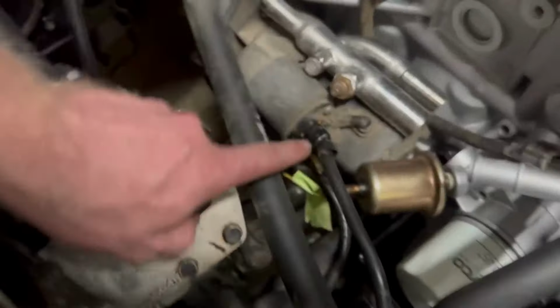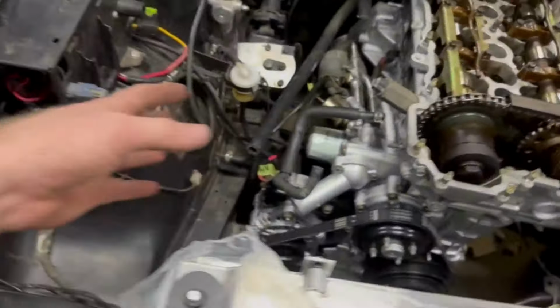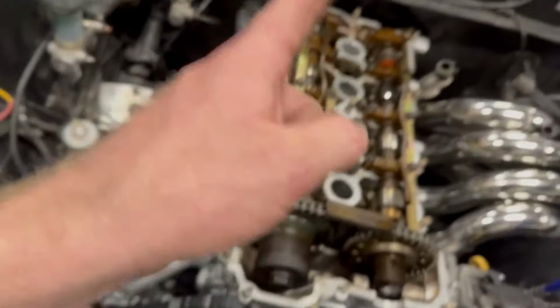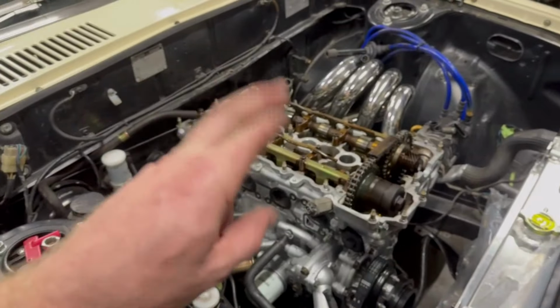You can see here, starter hooked up, alternator hooked up, alternator plug in. So battery wiring sorted out. It's literally just bolted up. All the L20 wiring has bolted up for the battery and alternator and starter and everything. So you know what that means? There is oil in that engine. That means we're about to put some power to it and kick it in the guts. Not quite. I'm going to put some power on it and I'm going to turn the engine over, hopefully, fingers crossed.